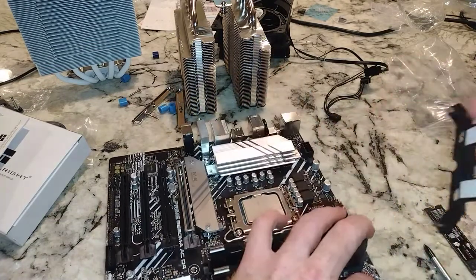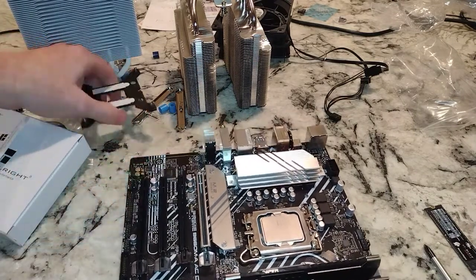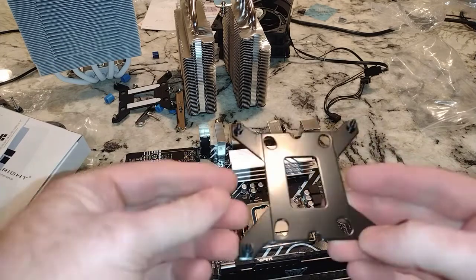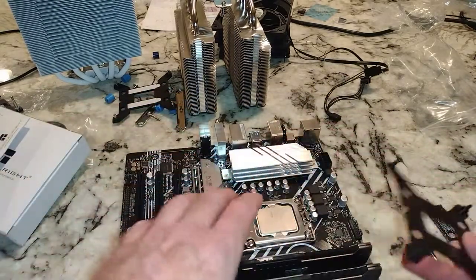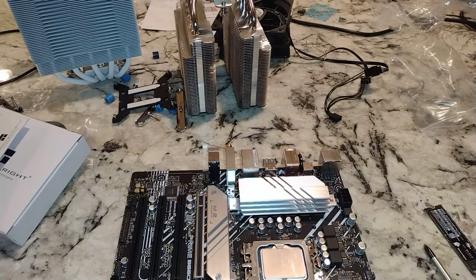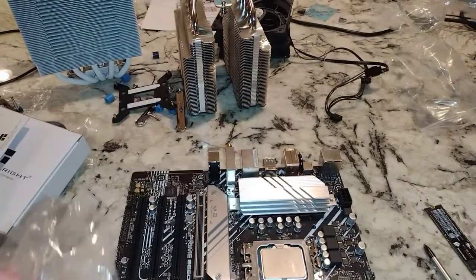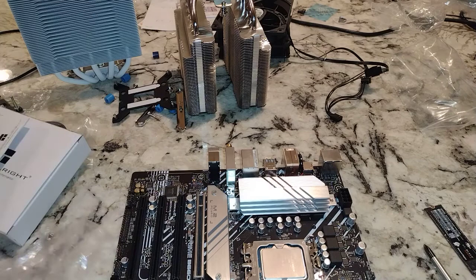Just in case I didn't tell you guys, this is an ASUS Prime B660M-A, if I remember correctly. So here is your LGA 1700 mounting plate. This can only go on — well, there's two ways it can go on. I'll go ahead and show you as I put that in there and drop that down. In the bag there are those spacer-type devices — I'll grab all four of them — and it looks like you screw these in by hand.